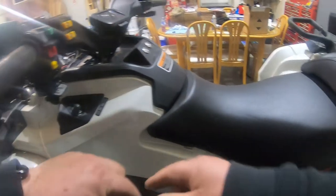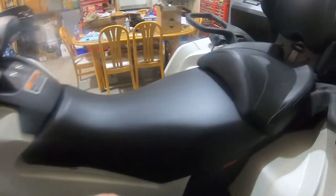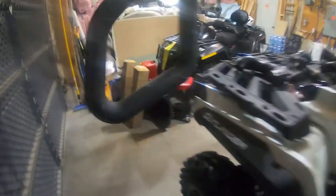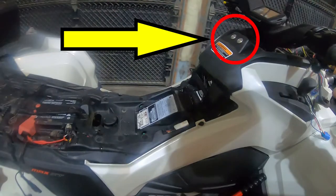There's my homemade tether, just so no branch knocks the key off while you're in the bush. The problem I had with the snorkel kit was the rigid pipe along the side panel — on your left leg it was pushing the panel. Even in the instructions it said you won't be able to use a push pin in there, there's no room to use a tie strap because the panel pushes out. It was bending the panel and the paint was starting to crack.